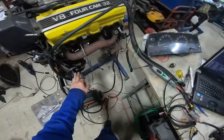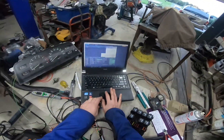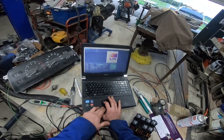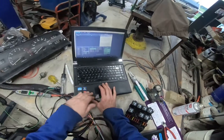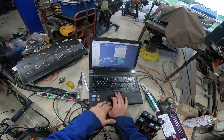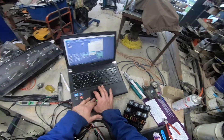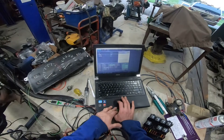With the sensor fitted, we've got the gauge hooked up to an auxiliary input. With the sender connected, we've configured one of the channels to the sensor on the analog inputs. We can see here Analog Volt 2 — double click on the top, bring up the menu, it says oil pressure. Then we've gone into the calibration table and entered the calibration for that sensor.